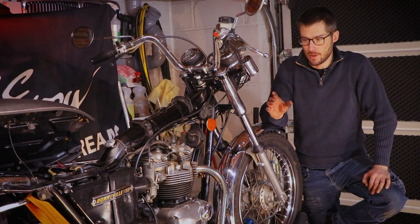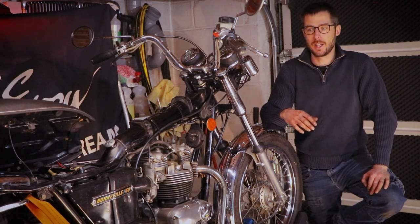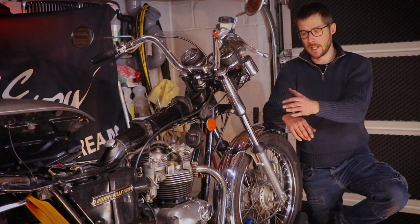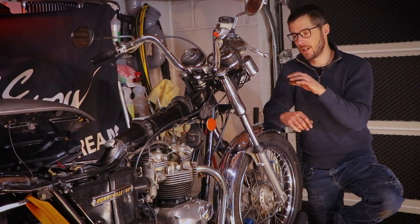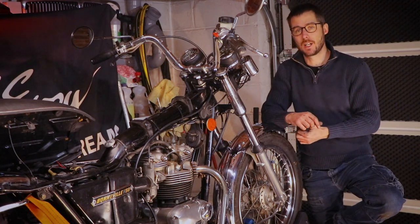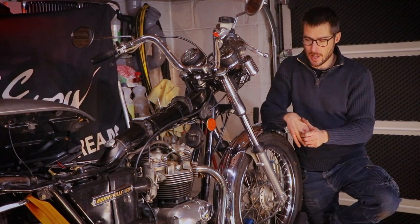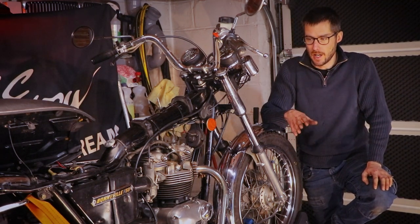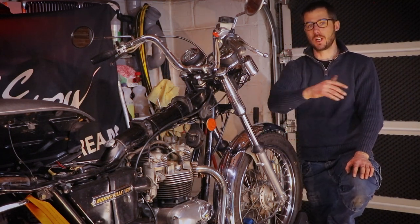Next up on the Triumph Bonneville maintenance series, I'll call it that for now, I'm going to address the rear end now. So I'd like to change the rear wheel bearing and clean and lubricate the chain and adjust that. And last but not least, I would like to perform an in-depth maintenance with the engine. So that's going to cover adjusting the chain in between the gearbox and the crankshaft, adjusting the valves, adjusting ignition timing, and so on and so forth. And obviously fine-tuning carburetors.